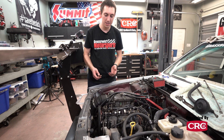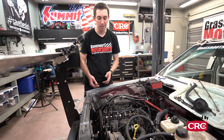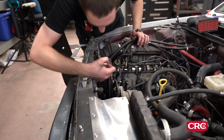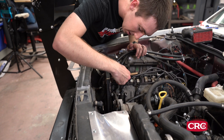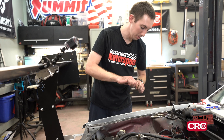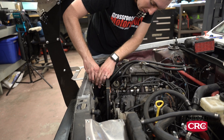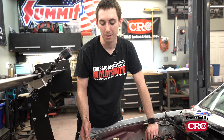Normally you'd put the engine at top dead center, double-check that everything lines up with its timing marks, take the timing belt off the right way, take the cam out, take the sprocket off — all of that. We're not going to do any of that. Instead I have my beautiful Sharpie. I'm going to mark the belt with what tooth it's on and mark the tooth on the timing sprocket too. As long as I don't let this timing belt slip on the crank and get it back on this mark, we should be good. I also have my beautiful timing belt retainment tool — just going to clip that right here to lightly keep the timing belt connected to the sprocket as I move things around. This is the wrong way to do this — don't do this — but it's quick and we're not that worried about it.